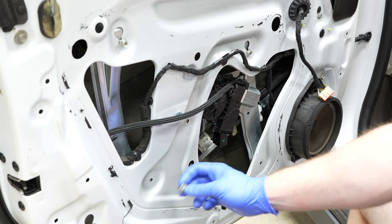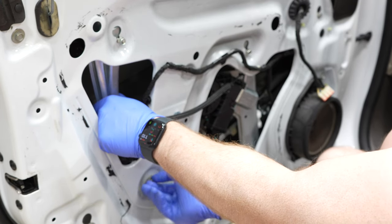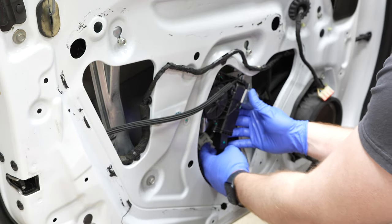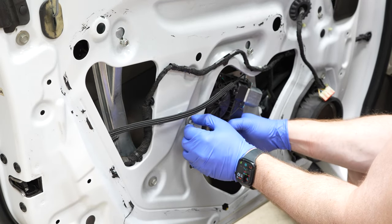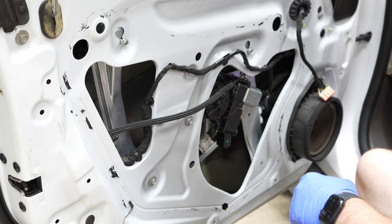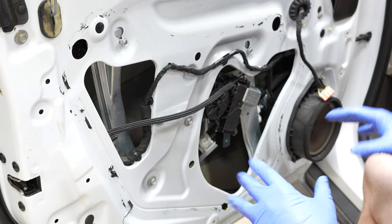Replace our bolts — you might have to move the track inside the door or lift up on it. You don't want to tighten them all the way down one at a time; you want to have them all start together and then tighten up evenly. I'm also matching up the witness marks from the washers on the door panel itself just to make sure everything goes back the way I took it apart.